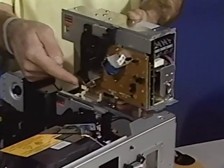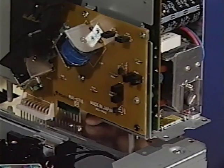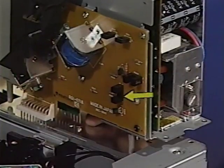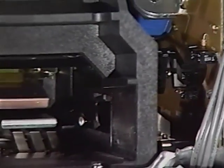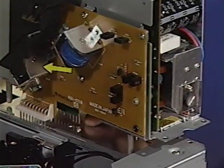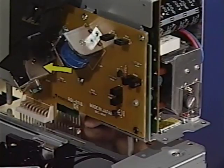This is the distribution PCA, located at the rear of the printer. Two solenoids and two sensors are located on the distribution PCA. Pickup roller solenoid SL301 causes the clutch to engage and turn the paper pickup roller. Paper out sensor PS301 senses the presence of paper in the cassette. Manual feed sensor PS302 senses the presence of paper which is manually fed into the printer. Registration roller clutch solenoid SL302 causes the registration rollers to rotate and paper to be fed toward the photosensitive drum.